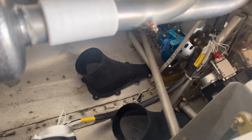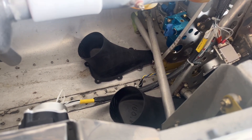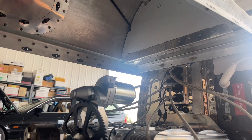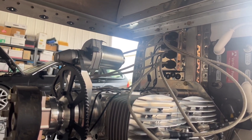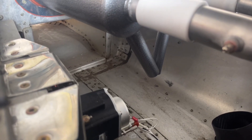I haven't cut the holes yet for the NACA ducts for the cooling system - I'm still deciding how I'm going to arrange that. I think I might build a box onto those that feeds the intake systems into the velocity stacks for the carburetors, then run scat tubing up to make something that turns this into a plenum above the engine and kind of seals that engine off so the air is forced to flow up into that plenum and then down across the engine. The suction is going to be created by the exhaust venturi, which was one of the Jim Beattie designs on the aircraft.